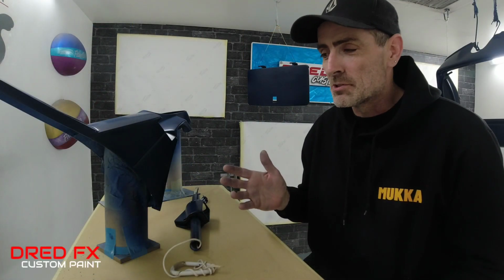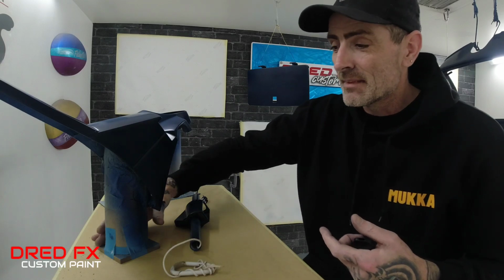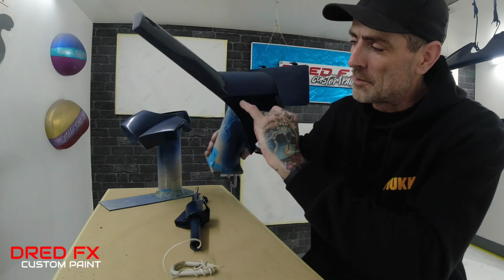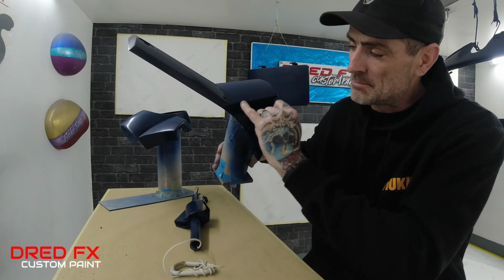Did that little bit there in real time for you. So we dropped the blue base coat in the PS290 and it did spit out for a start. There's a little bit of overspray that spat over. The cap was a little bit loose. Sorted that out. We've dropped the blue in where I broke through when I Scotch-Brited it. So that's puffed in on the blue.